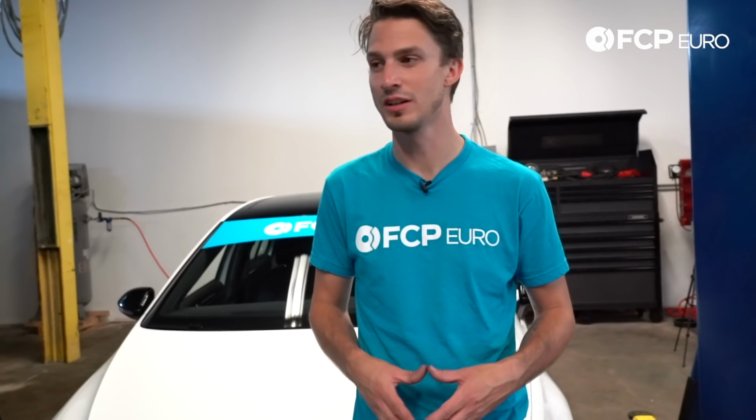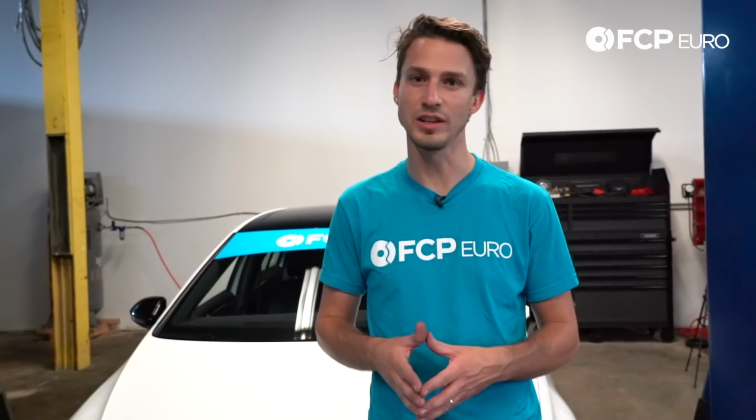All right, everyone, we just got through test driving our MK7 GTI with the new 034 sway bar and end links installed. Honestly, on a straight line, you don't really notice it. It's really not there. And then in the turns, you notice the roll stiffness. You notice the car wanting to rotate, especially in the mid to high speed corners. Really great upgrade for these cars. Really livens up the chassis. Totally suggest it. Really easy install. All around, big thumbs up.